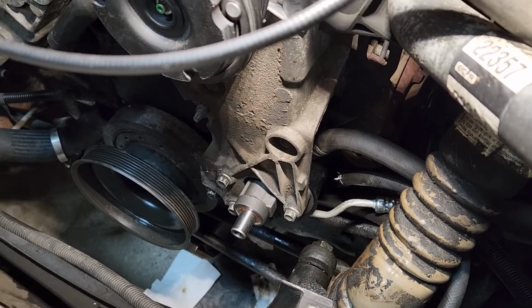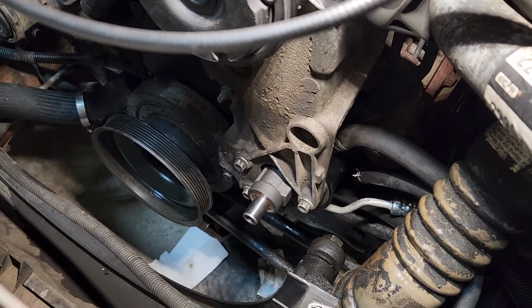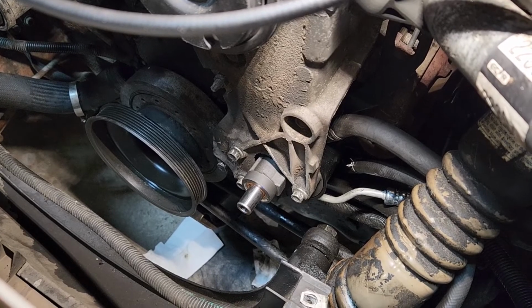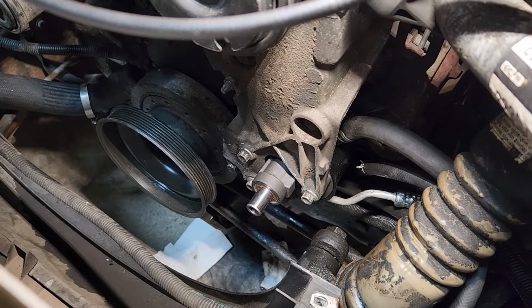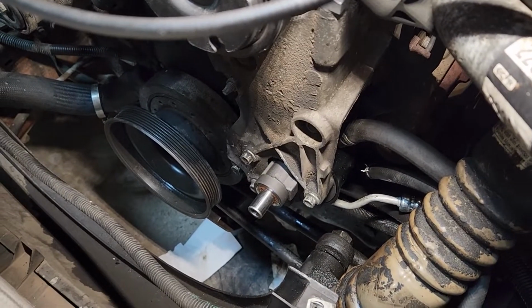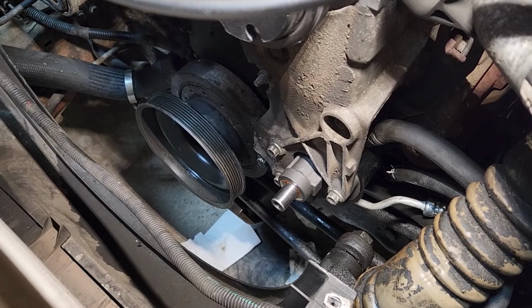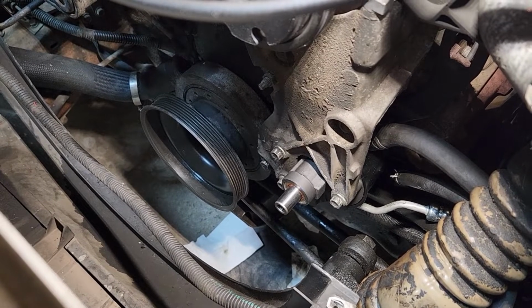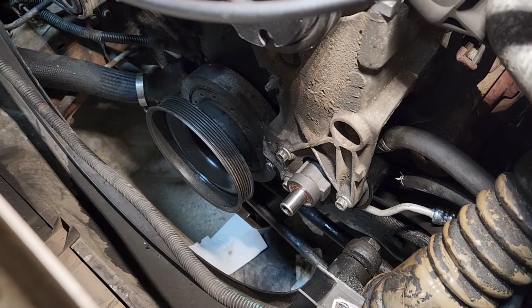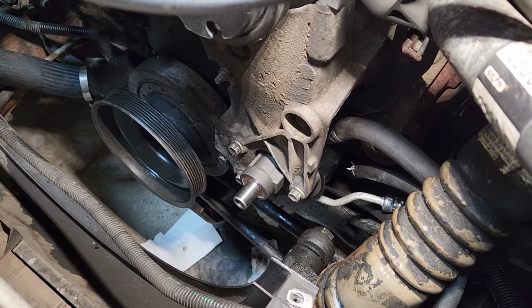We are now ready for the pulley. The support bracket on the back, those are 9/16. I got those tightened up. These three here on the front, they all went in very easily. I was able to run them up to almost tight with my finger, so I know that's got it lined up the way it should. Didn't have to force anything or strip a bolt.